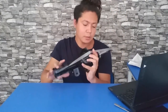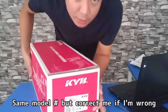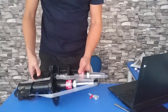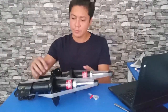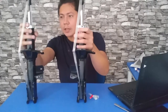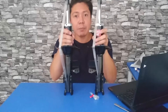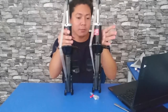You can see the KYB branding on the shock. A pair of KYB gas shock absorbers come in two different boxes to indicate which is for the left side and which is for the right side — you can tell by the difference on this part. A tip: if you're going to install something like this, always take one old part first and compare it to any of the new ones so that you will know which is which for that specific part of the car.